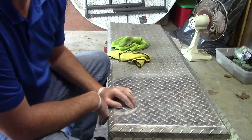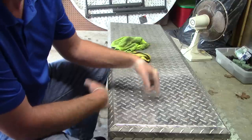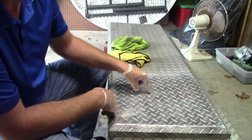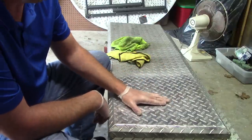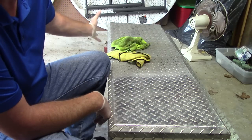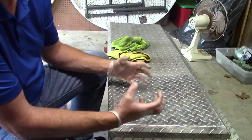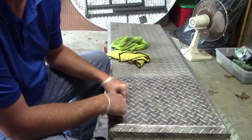Just wanted to go over that with you quickly. That's how I would do this as a beginner without a rotary — I didn't want to use a dual action polisher with a microfiber cutting pad and chew it up on these diamond plates. That Flitz ball with the Flitz polish works amazingly well to polish these things out and get you some nice pop. You don't have to spend forever on these either — maybe this box takes you 35 to 40 minutes to do all the way around. Restoring it and getting some nice shine looks great in the back of the pickup truck and makes extra money while giving value to your customer.